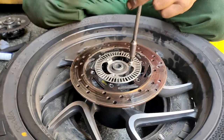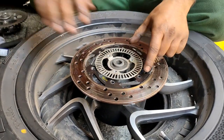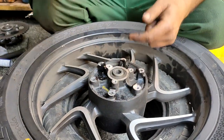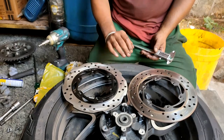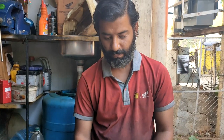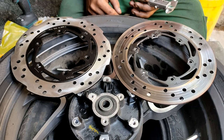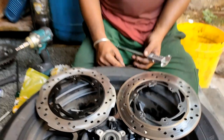We are opening up the ABS sensor disc — this is what gives feedback to your ECU that the rear is locked up, so it releases the brakes when the front is still rolling. Let me show you a quick look at how the disc looks. The one on the left is brand new and the one on the right is the old one.